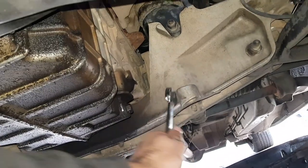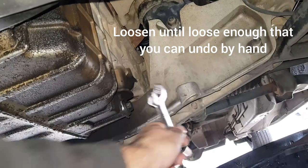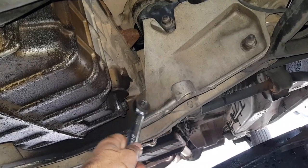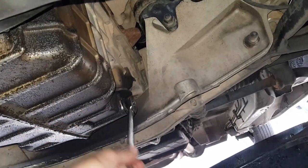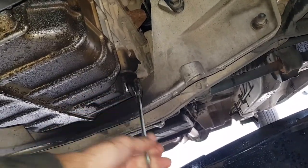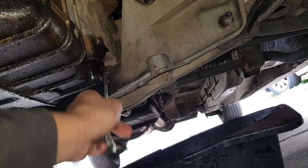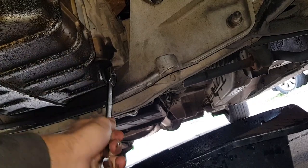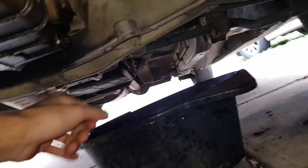For anyone that hasn't done this before, by 'crack it open' I mean you want to have this opening just a little bit like that, and you should be able to do the rest by hand. I've got a ratcheting end on this spanner and I like to get it to a point — make sure your drip tray is handy in case you start getting some drips. I'd like to get it to a point that it's really loose and easy. I'm feeling that it's quite loose — let's give it a test by hand.